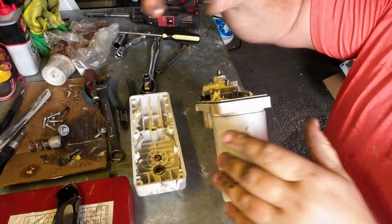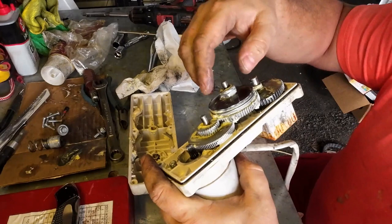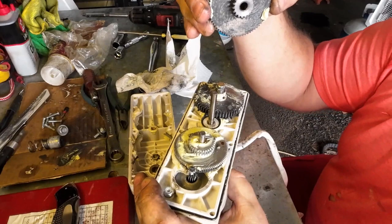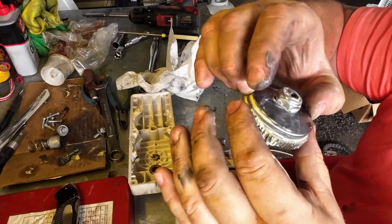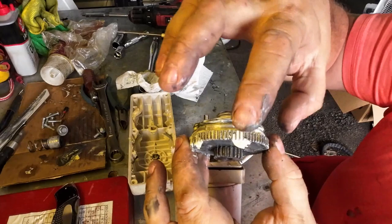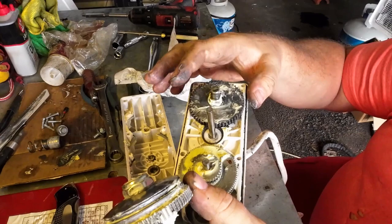Let me get a paper towel — it looks kind of loose. I haven't had this apart but you can see this top metal plate, looks like there's some springs in there. It's wavy — looks like it might be a little bit loose. The grease is all gunky on the bottom, but I think this gear should be driven by a slot in here. If I wiggle the nut on top you can see the gear kind of moving down there. So the motor is driving this outer gear, transferring through this clutch to this shaft, which then transfers over and drives the leg up and down.